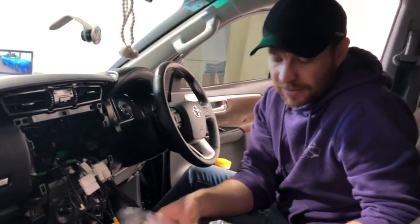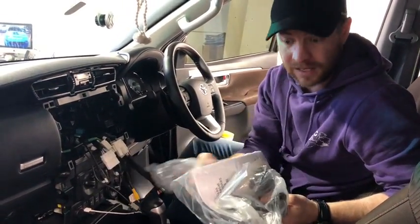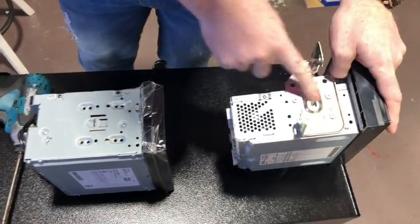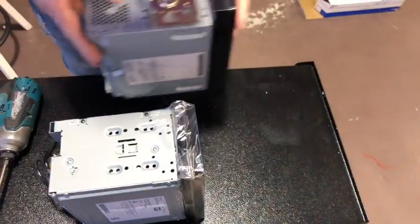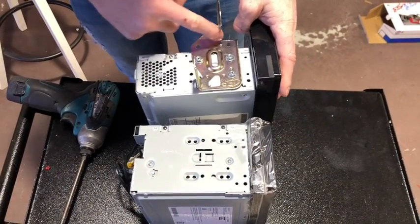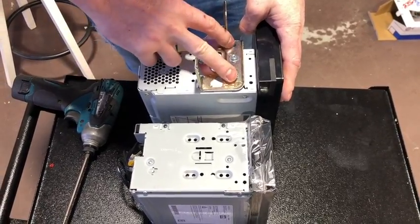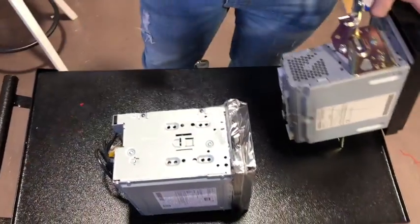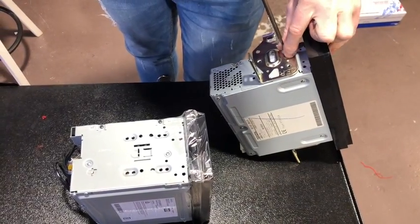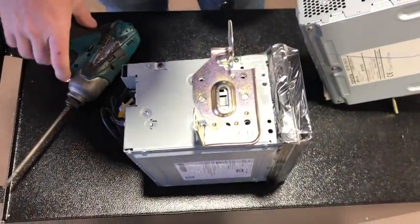The only remaining things are to quickly mount the brackets and run a USB into the glove box while we run the microphone. For the brackets, you've got three screws on the side — left and right, passenger and driver. You can line them up and you'll notice these screws line up with the holes here. Toyota have used the higher holes — we're going to use these two here. This is an 8mm socket; put it on and all three line up.